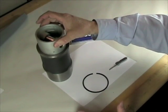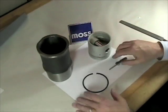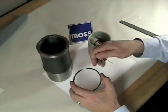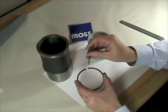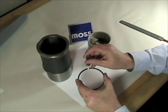The piston will push down about an inch or so. What that will do is put the ring nice and level inside the cylinder. With the ring nice and level like that, find out from your shop manual how big a gap you're allowed to have. Get your feeler gauge, set it to that, reach down the cylinder wall and feel the gap.